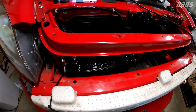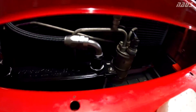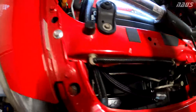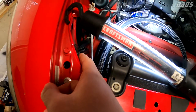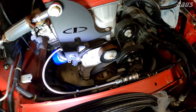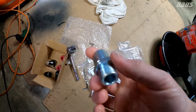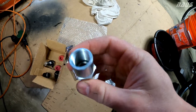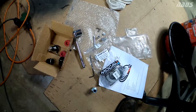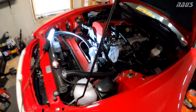I've got the oil cooler routed now. I filled it with oil — took probably close to a quart for the cooler itself. I've got the 45-degree fitting hose end on this side routing nicely up through there, and the 90-degree on the far side. These two lines come through this cavity right here. As you saw in my last video, I did relocate my oil pressure sensor, and now I'm removing the oil filter and putting the sandwich plate on. It recreates the oil filter threads on the other side with a female fitting to go straight on.